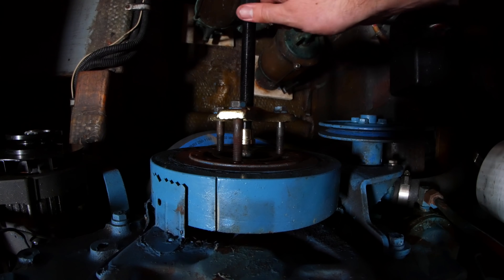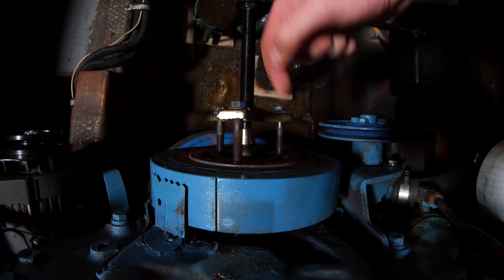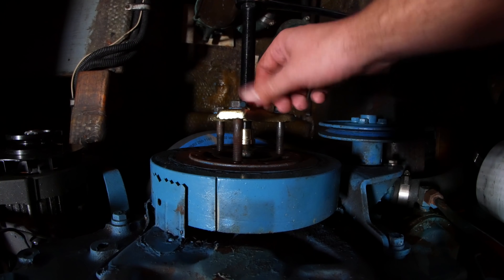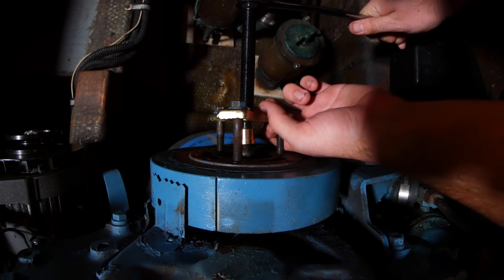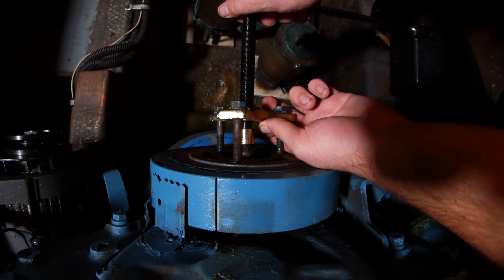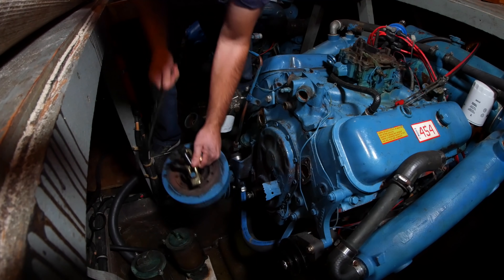What I've got to do is turn this wrench on the hex part at the end. That's going to push this threaded rod in, and the only way for things to move is for the bolt and the tee fitting to come out. I've got to make sure I catch it before it hits the inside of the hole — I don't want this thing doing any damage. Nothing to it but to do it. And there it is.